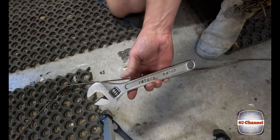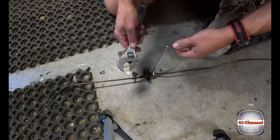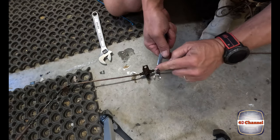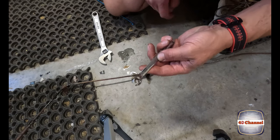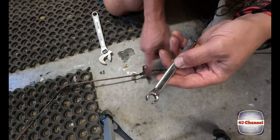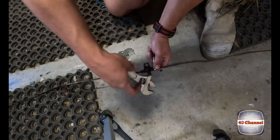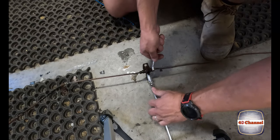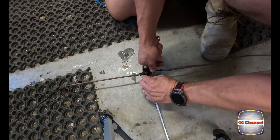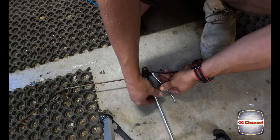You may even need to use some heat on really stubborn ones. Let's give the R10 a go. Grab a shifter - this one is actually a Toyota motor shifter - the shifter is just there to hold one side to stop it spinning when you're trying to undo it. The beauty of the brake line spanner is it's almost a full ring spanner with a little notch cut out of it, which grabs the end without it spinning and stripping. Don't use an open end spanner or you'll strip the nut.